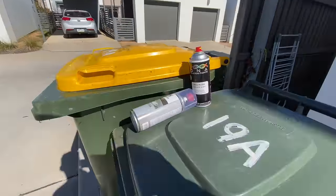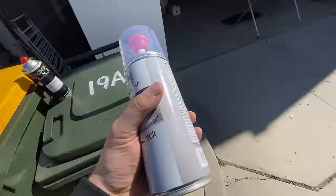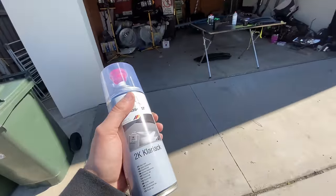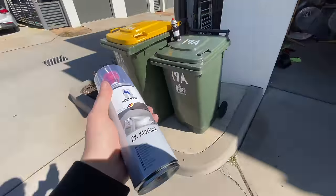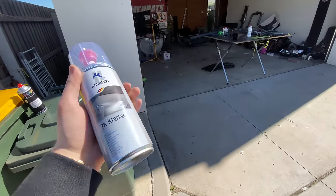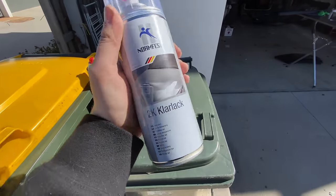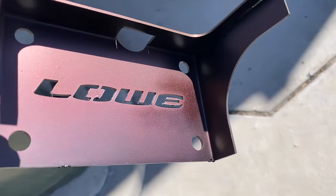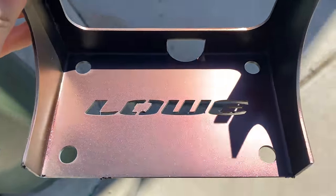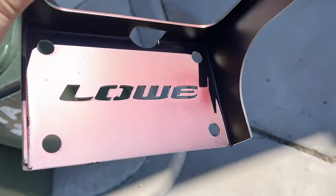It is always good to warm up your clear coat. It was cold this morning but it's actually really nice weather today. Warming up any paint — getting it to room temperature — means it atomizes better and comes out of the can or gun better. It'll always look better if it's at least got some temperature to it. Don't paint clear when it's cold. You can see that tiny bit where it's still flashing off, but once it dries it has a bit of a flat texture — so let's chuck some clear coat on it.